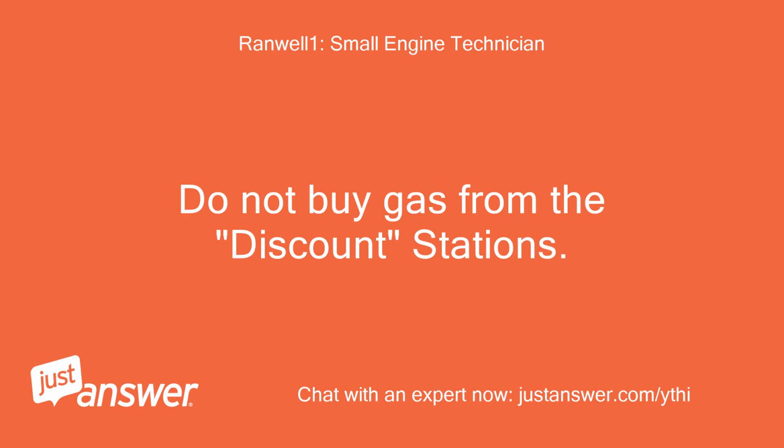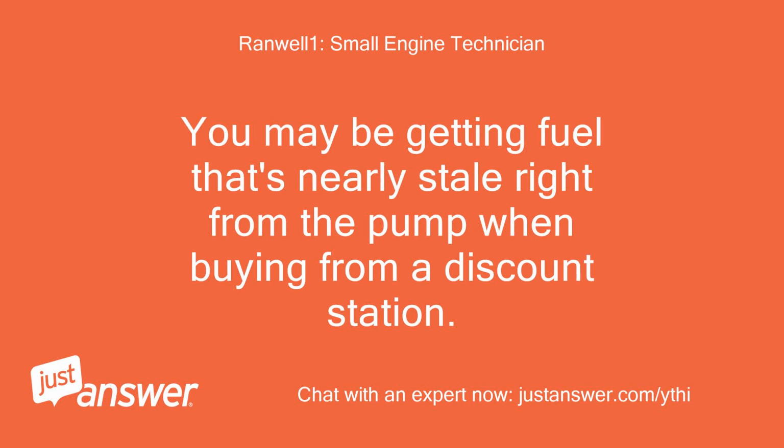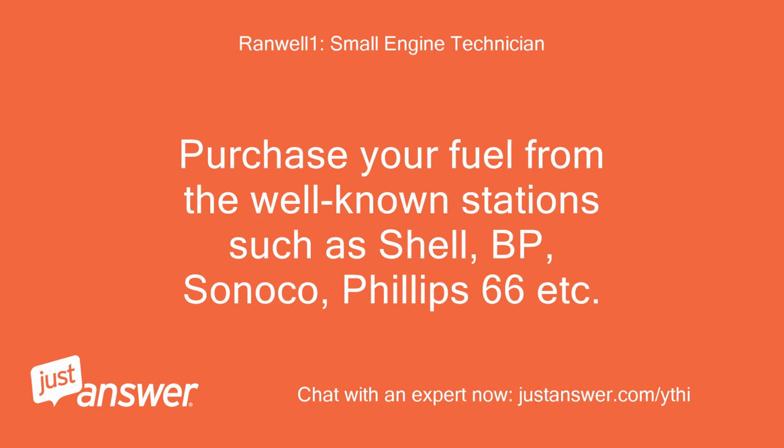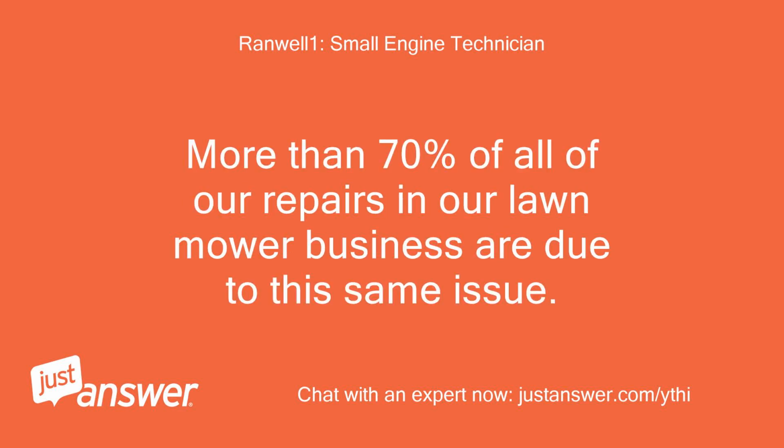Do not buy gas from the discount stations. The discount station gas usually does not have the additives needed to keep the fuel system clean, and it deteriorates much more quickly than good gas station gas. You may be getting fuel that's nearly stale right from the pump when buying from a discount station. Purchase your fuel from the well-known stations such as Shell, BP, Sunoco, Phillips 66, etc. I never recommend using Speedway gas. More than 70% of all of our repairs in our lawnmower business are due to this same issue.